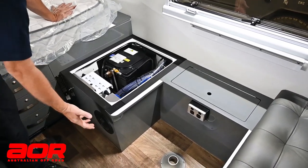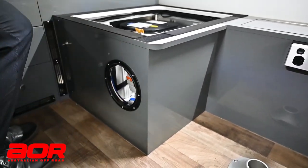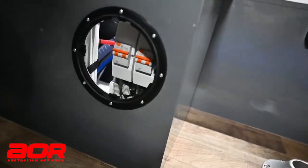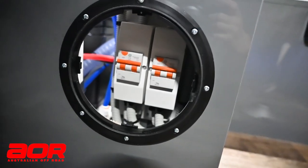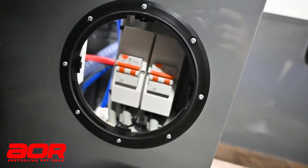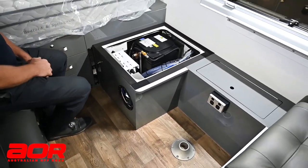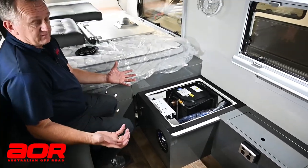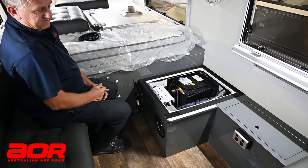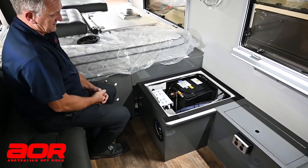On the outside you'll notice this large black dial here. This is the safety side of things with our 240 volt and our 12 volt electrical — they're standard household safety throw-out switches. On a rough corrugated or pothole road, there is potential for those to trip out, and then when you plug in your 240 volt you won't be able to access power. Just like at home, flick them back in and they're working again. They're essentially a fusible link.